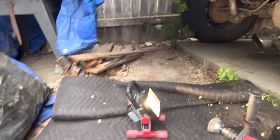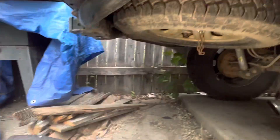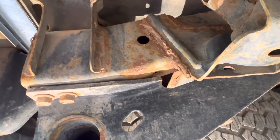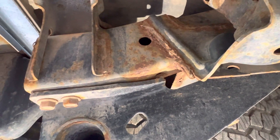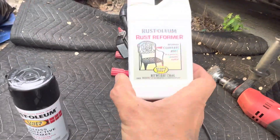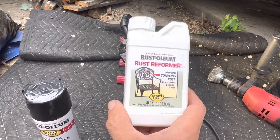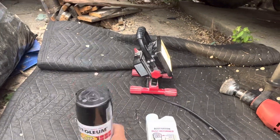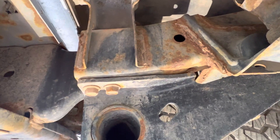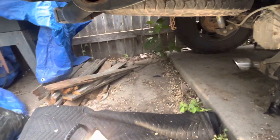What you're going to do is take your wire brushes, hand brushes, and spin brushes — even some sandpaper — and get up in there. You can see right there I've got a really nice spot I've got to work on. Clean all that loose rust off, get down to nice clean metal. You want a nice clean surface for the rust reformer to adhere to, because it's going to physically and chemically turn your rust into a hardened surface that is then paintable. Clean that off really good, then soap and water it to remove any dust, and you'll have a nice clean surface to apply your Rust-Oleum Rust Reformer.